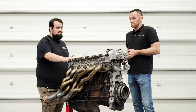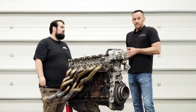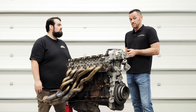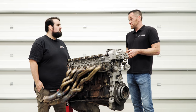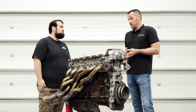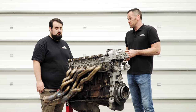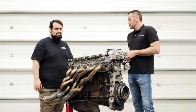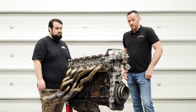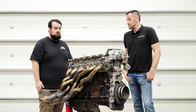So the unit on this, I don't think it's as bad as on the E46s. Is it failure-wise and that kind of thing? The unit itself on this is more complicated in size. You've got a lot more seals and a lot more moving parts to it. An E46 has fewer parts inside the actual case itself, but there's more to go wrong from the engine side. So cam gears and chain guides, bolts that come loose, where this doesn't happen on this engine. So this is the last of the over-engineered engines, I would say, where everything was built to last rather than built to a cost. Well, it's good to know that, because I'm not changing the engine. No, definitely not. They are a good engine. The E46 is a bit lighter inside, it revs a bit harder, but in terms of performance, there's very little difference in them, really.